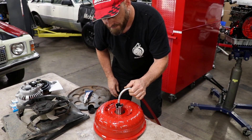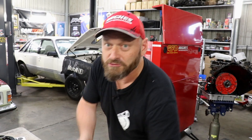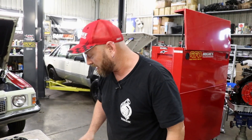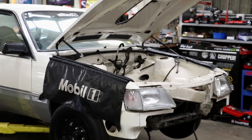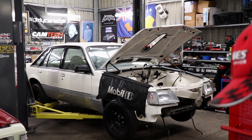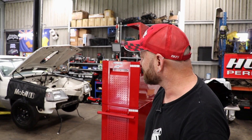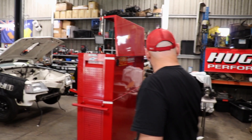You don't actually have to fill the converter up but I prefer not to put them in completely dry because they're all mechanical components going around in there. If you fill them up too much it just pours out inside your bell housing anyway. Speaking of mechanical components — what's the go with this hectic white VK in the back? It's like the world's cleanest VK. Actually it's the world's best VK bonnet, so Dave reckons. Murray used to own that car — Big Mars — and he sold it to Dave and there was some controversy about flat top pistons and stuff. Quite the hubbub in the day.